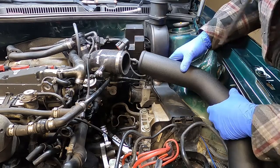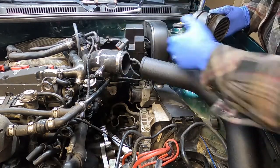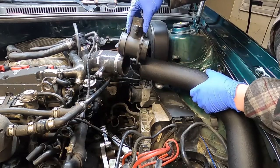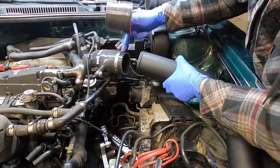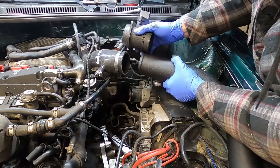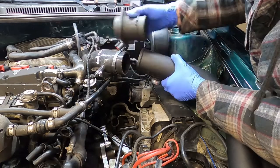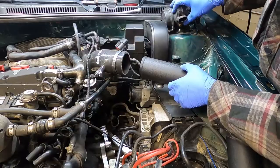The last problem I had was installing the MAF and intake back to the turbo inlet pipe. The turbo inlet pipe is too long for my setup, even though it worked fine on the stock setup. I ultimately ended up trimming the turbo inlet pipe so that it would fit properly with the intake and the MAF — not something I wanted to do, but it's what I had to do. Your situation might be different depending on the intake that you have or the stock airbox, so do what you have to do to make it fit.